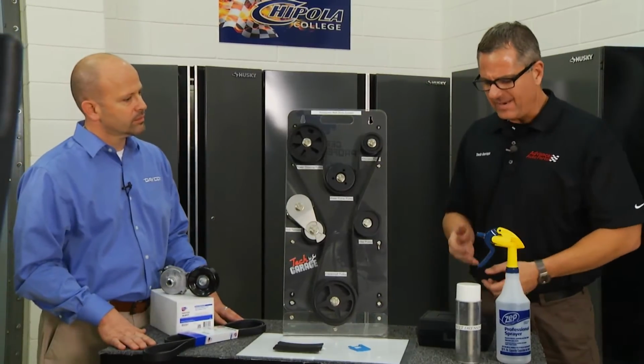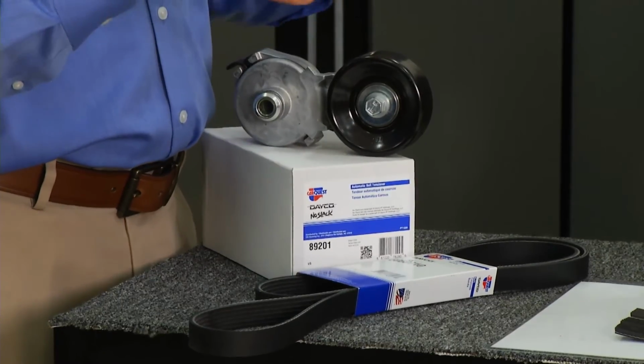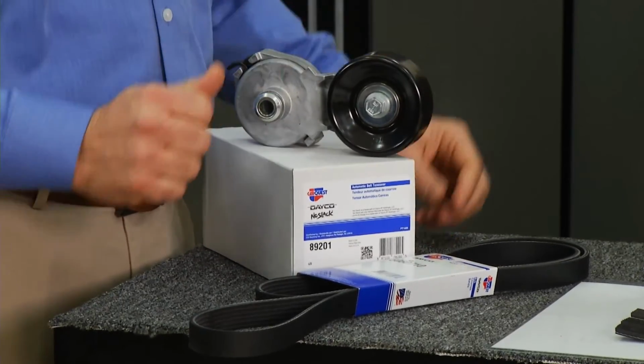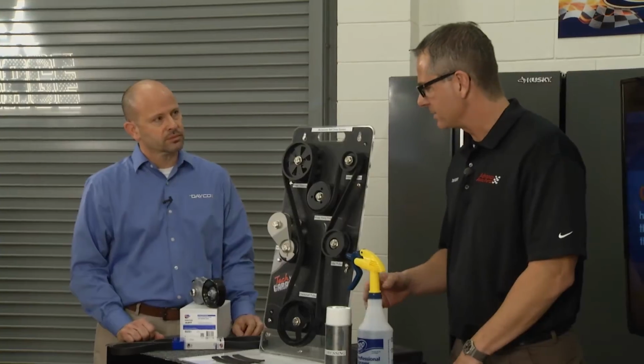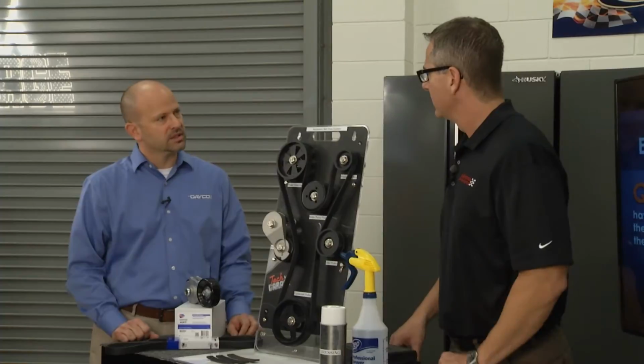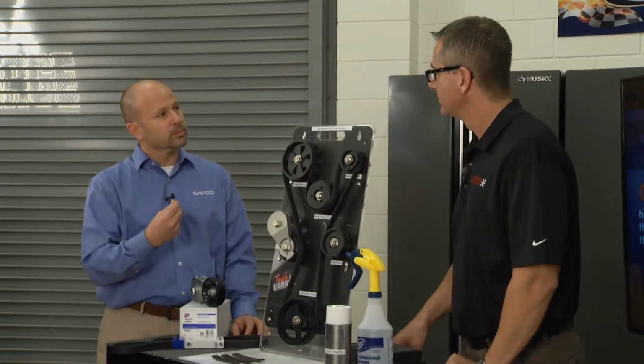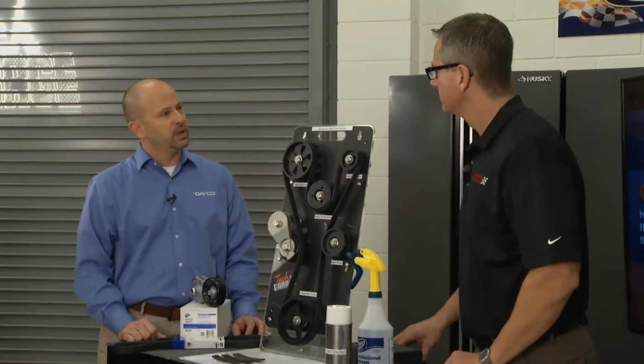Robert Christie from Dayco. I'm glad you're here. What can you share about belt dressing? Well, you're exactly right, John. Belt dressing with today's EPDM belts, they may mask the problem for the short term, but the EPDM absorbs those oils and causes the ribs to swell. So when it returns, it's even worse. Now, you can use that on some older belts. You said EPDM, we checked them earlier, versus the old neoprene belts? Yes, the neoprene belts were less resistant to oil, or absorbent to oil, I should say, than the EPDM.